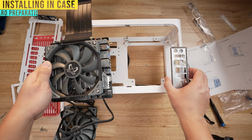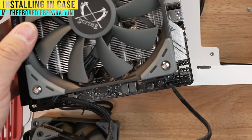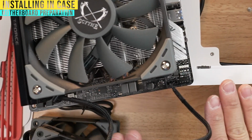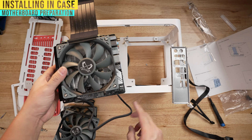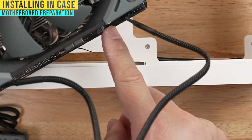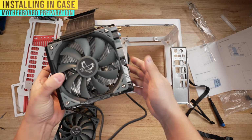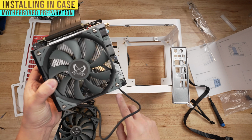The other thing that I noticed is that here on the bottom, when I try to insert this in, everything on the bottom here, basically you can't access anymore. And that's got a couple of issues. One is that one of the motherboard standoff screws is actually here, this hole. You can't access that. I'm not too worried. This is not that heavy. I think it's fine with the three screws, but the more important part is my fan headers.